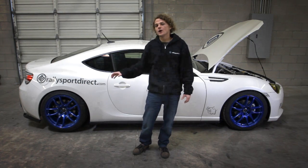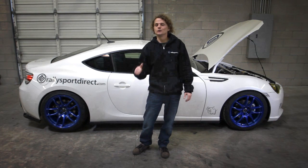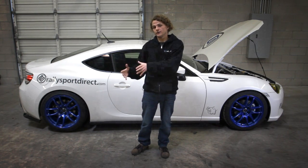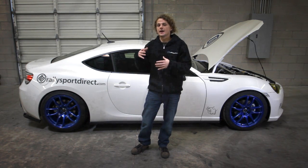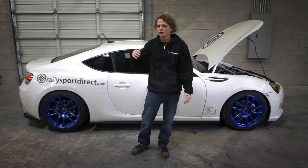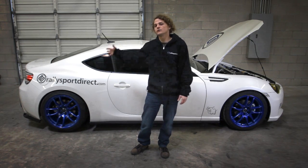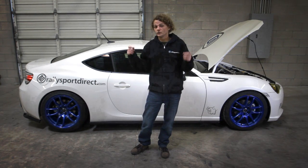My favorite mod that we just did is Tein hooked us up with a set of brand new Street Flex coilovers. Now, this is their new line of the, you guys are familiar with the Flex coilovers, and this is basically just an improvement on that. Now, the thing I liked about that most is the fact that you still retain a lot of comfort. You get the camber adjustment top hats in the front. Of course, the rear you can't adjust camber because of the way the rear suspension is set up. But you have full height adjustment and full damping adjustment.